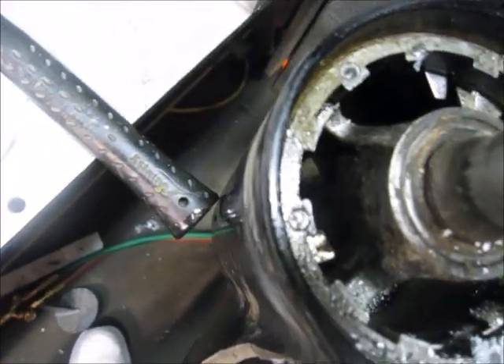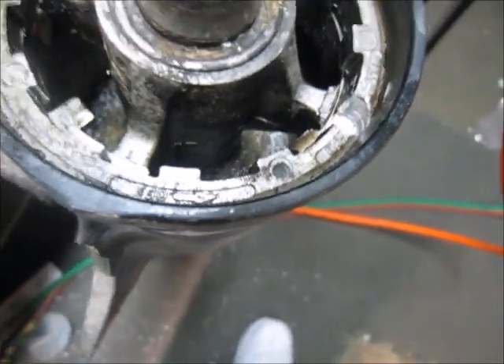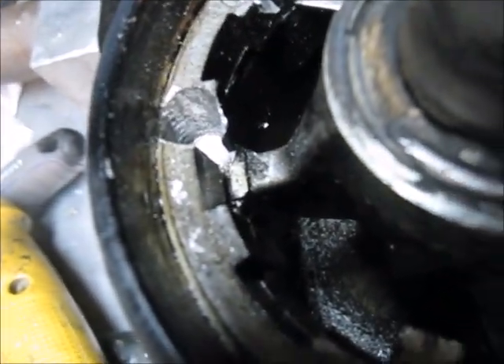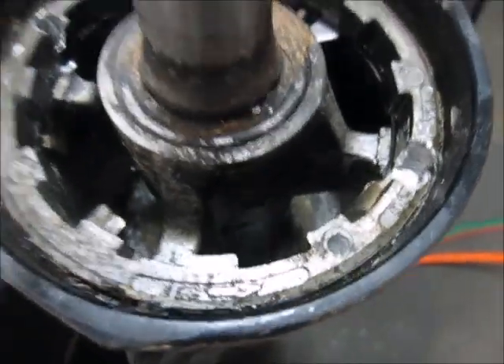You do both sides, and then we're going to collapse it down. After this pilot hole, you put a larger bit in. That's our hole - we drilled a 13/32 hole. You just need to get it so that it just touches the outside thread area so we can collapse it. You would just take a screwdriver or a punch and just give this a tap - and it should break it loose. As you can see I just pushed it forward and it came loose fairly easily.